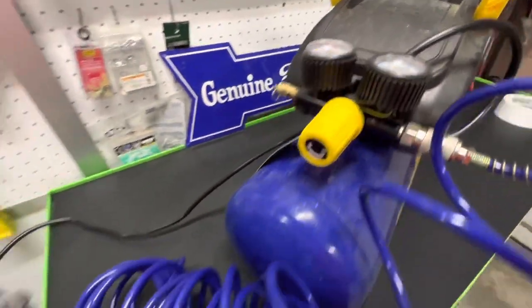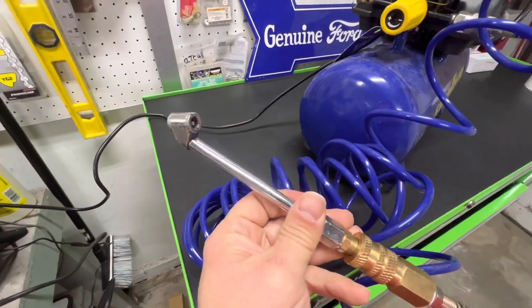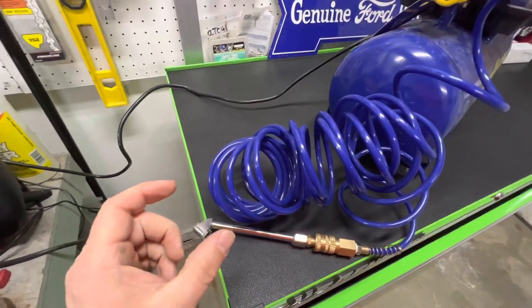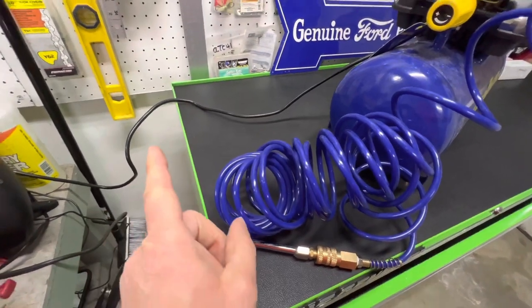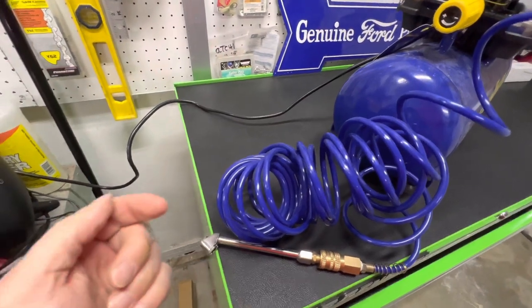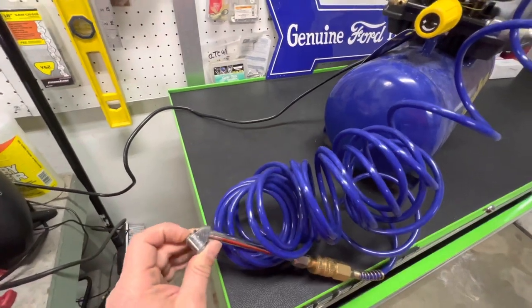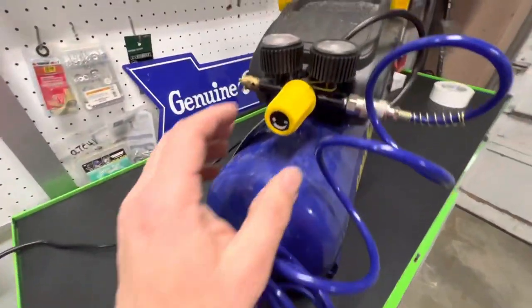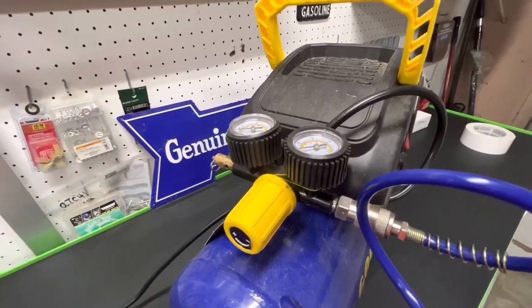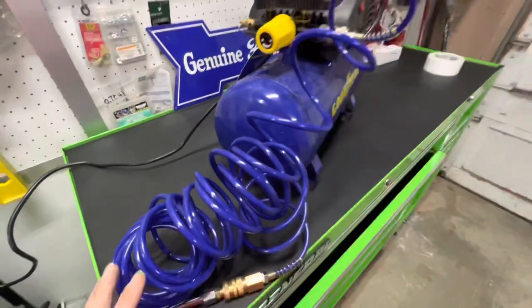When I'm blowing out the lines in my RV, I've got this chuck on the end of it for inflating tires. On my RV, I have a little adapter that goes into the water inlet and screws in. I think I got it on Amazon and it has a little valve, like a bicycle tire valve sticking out. I can press this onto it and I bring the PSI down — I think it's like 25 or so. Just enough to blow the lines out and you don't have to worry about bursting a line with the air. But it works great for that.